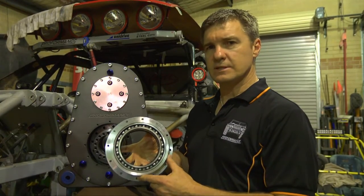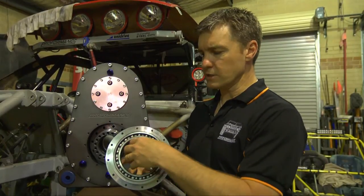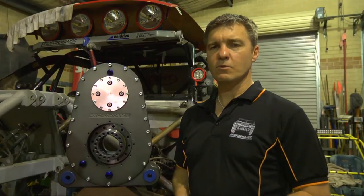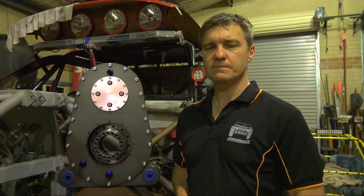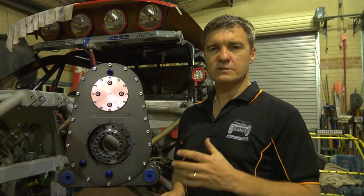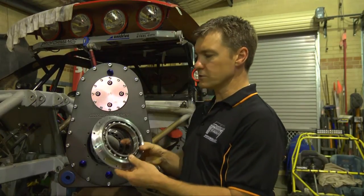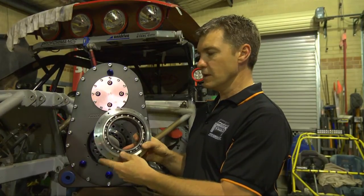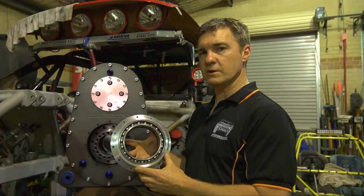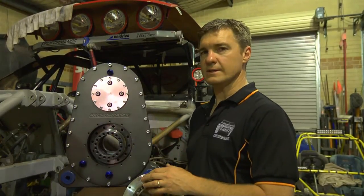Taking a look at the bearings in our transfer case, you'll notice they're a little bit larger than what you might find in most transfer cases. We're not using any output shafts or spline shafts — our gears are actually supported by a large diameter spool which sits in these 110mm bearings. We see a lot of highly stressed off-road components manufactured around the world where bearings are mounted directly inside the aluminium carrier or case. At Proformance we do not recommend mounting bearings onto an aluminium surface. Highly stressed off-road racing and rock crawling cause the bearings to fret, move back and forth, and sometimes if a bearing fails it just spins in the housing and your case is completely destroyed. At Proformance we've chosen to put all of our bearings into 4140 chrome moly steel bearing retainers. These bearing retainers bolt in place into the aluminium housing, preventing them from walking, fretting or coming loose. Should you ever experience a bearing failure, the worst it can do is damage the bearing retainer, which is far less expensive than replacing the whole housing.